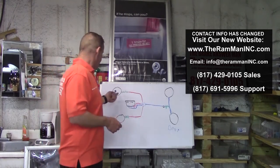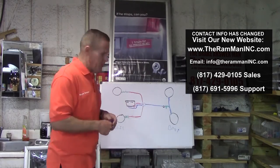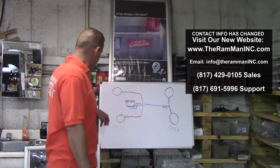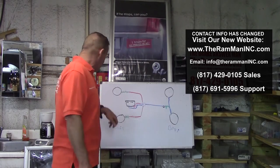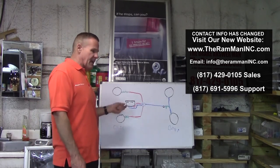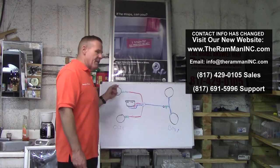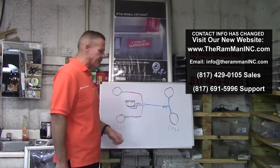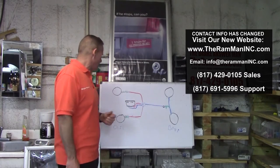Calipers can get mounted upside down by mistake, and you can never bleed them properly. Remember that bleeder screws always have to be at the top so air can escape. On the early cars, the pin caliper setups, sometimes they can get little air pockets at the top. The Kelsey-Hayes pin caliper, used 1970 through 1974 on the C, B, and E bodies, is often difficult to bleed out. They actually recommend in one of the old service bulletins to gravity bleed those — just keep your master cylinder full, open up the bleeders, and let it run for a few minutes or an hour.